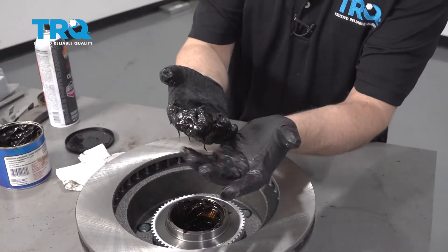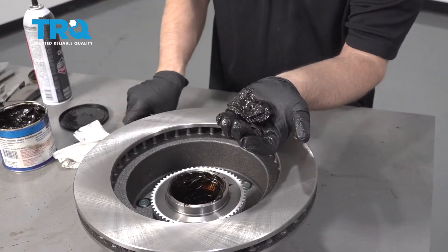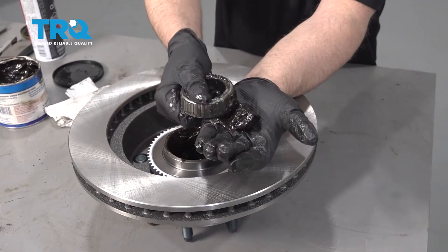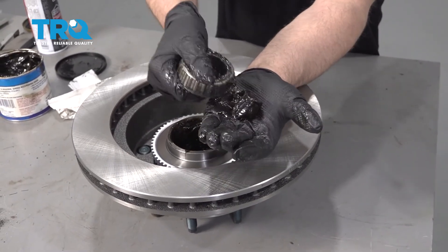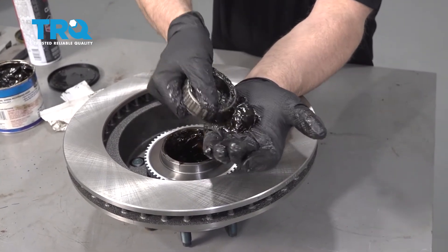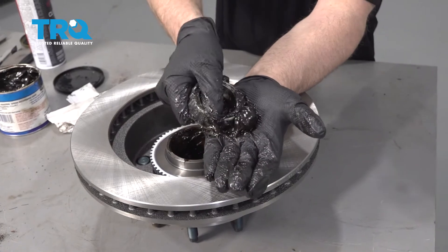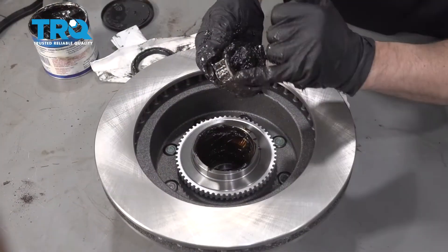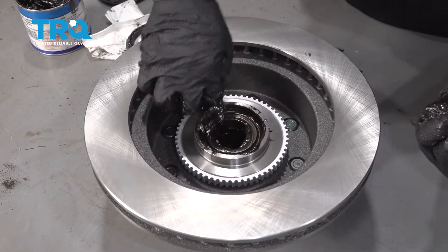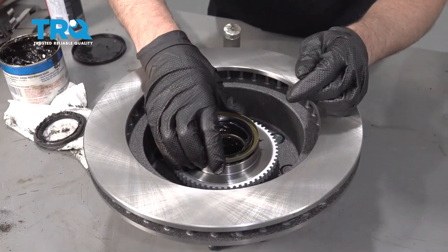You can use a tool or do it with your hand. Take some grease in the palm of your hand and push the grease into the bearing — you're basically wiping the grease in. Eventually you're gonna see the grease start coming out of there; that's when you know that side is packed. Move the bearing and do the same thing all the way around until it's all packed full of grease. Now slide that in position and spread it around a little bit.